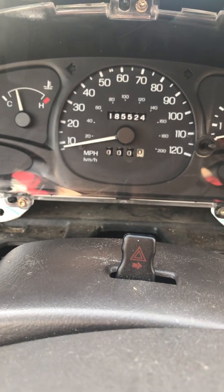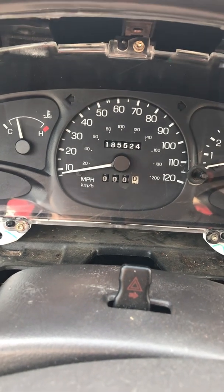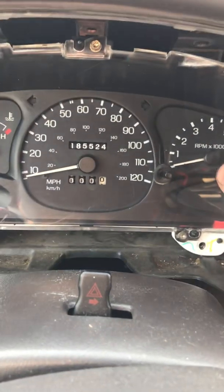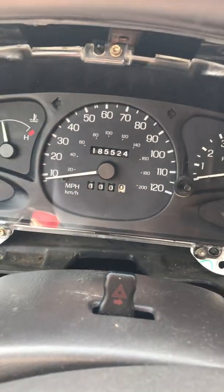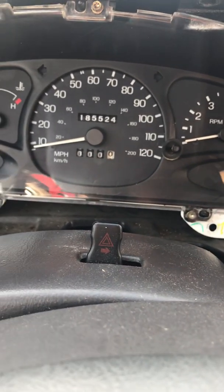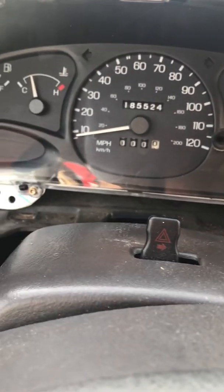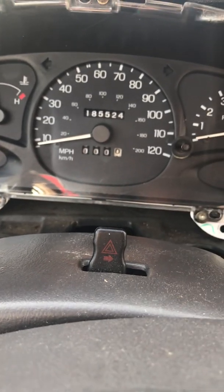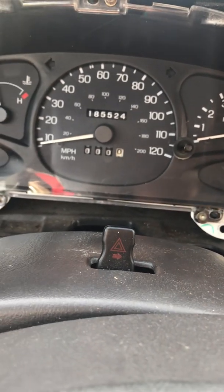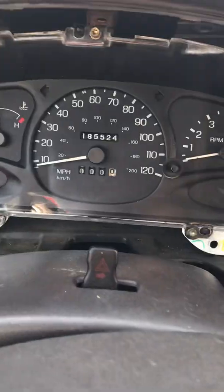Fortunate enough for me, I've bought enough dashboards that I've got one that works. That's another rule — you should always carry backups. Now, what I mean by electronic: most Fords up to 94 use a cable in the back. Just your standard cable runs the needle, and there are gears inside that roll the numbers over based on how fast the magnet moves. About 95, Ford decided to take all of its speedometers and make them electronic.